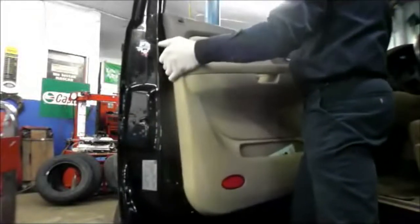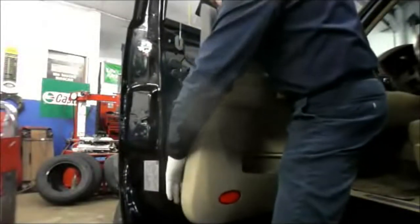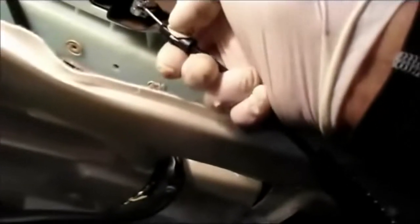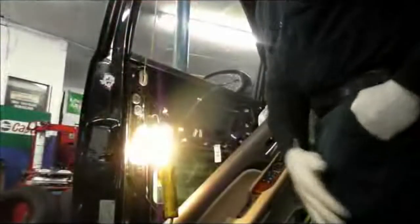Once you've got all the clips popped out, you'll lift the door panel up and pull it off. The way you take the cable out in the back is: there's a little piece here — you just push it down with the screwdriver here and here, and you're able to get that cable off the door. Then lift the panel up and off, removing it from the door, and unplug the electrical connectors in the back. There's also a cover that sticks on with glue — we'll continue removing that to gain access inside. Then roll the window back up so we can look inside the door.